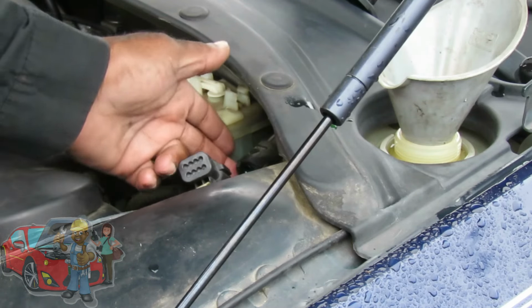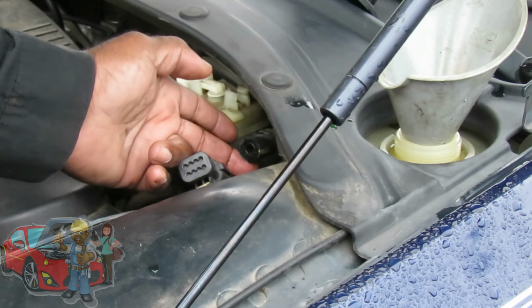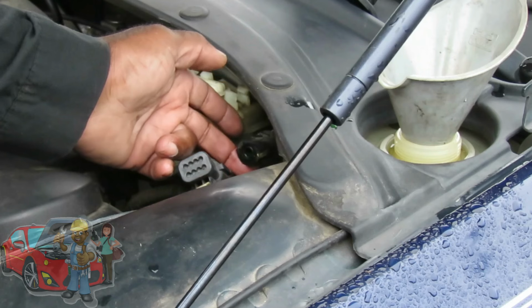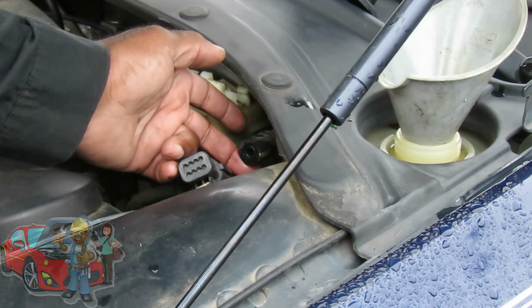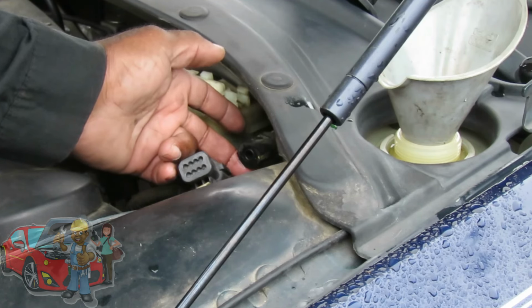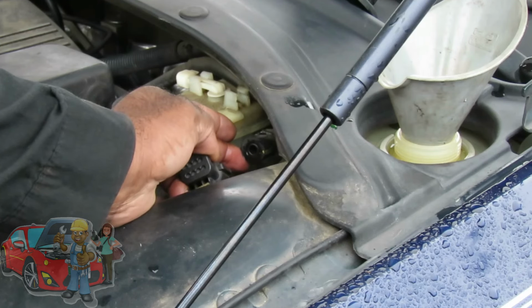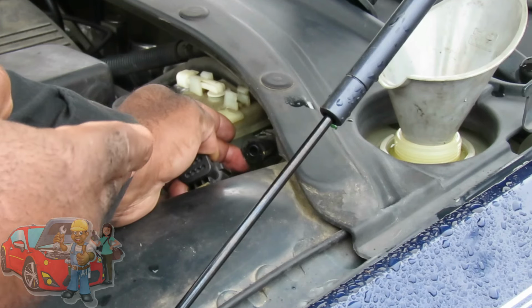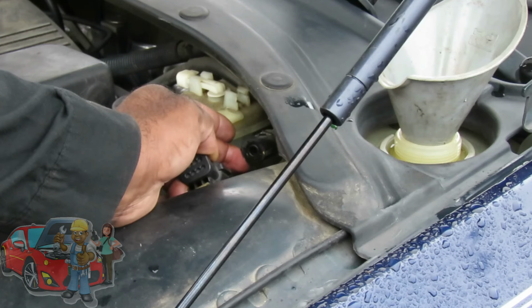You can see it. You saw how it was just burping out just a little bit. Right now, this system's not even bled. I got the AC, I got the heating on. So we're just gonna sit here and let this thing bleed out by itself. There it is, starting to come out a little bit more. And you gotta be patient with this. So we're gonna sit here and just wait. And at the same time, make sure your antifreeze level stays pretty good. As you saw then, some came out again. So we definitely got air in this system.